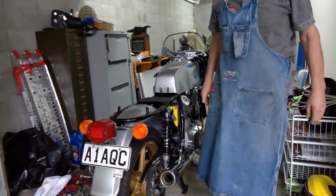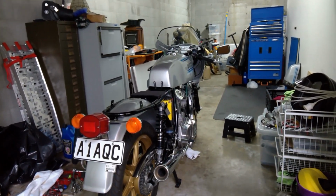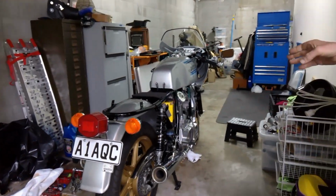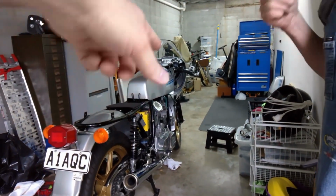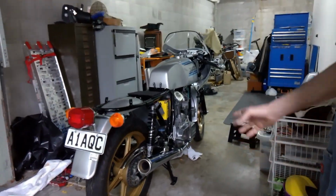It sounds much more sensitive on the throttle. It's like twice as good. You went to your right. Yeah, that was. It sounded like a race bike now. It definitely has got an exhaust leak. I can hear that pop, you hear that pop when I let the throttle go? Yes, that's that leak. Got to fix that.